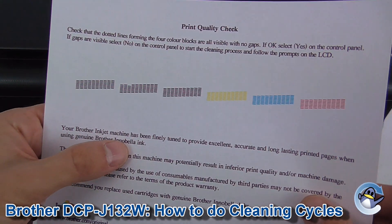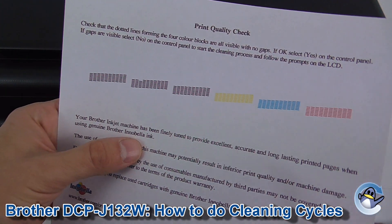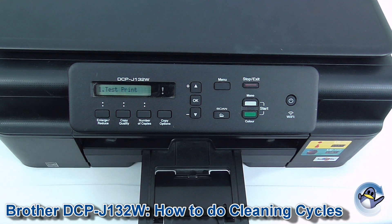The test page looks a little bit like this, with a breakdown of all the colors. Just look for missing dots to confirm the quality, or lack thereof, on your printer. It'll also reveal lines going across your prints — if any parts of the pattern are missing, that indicates a problem.